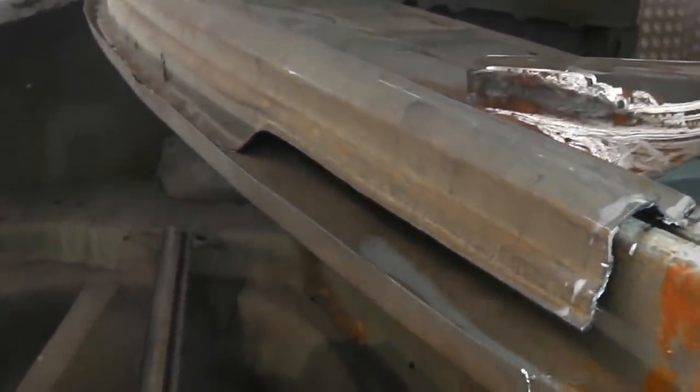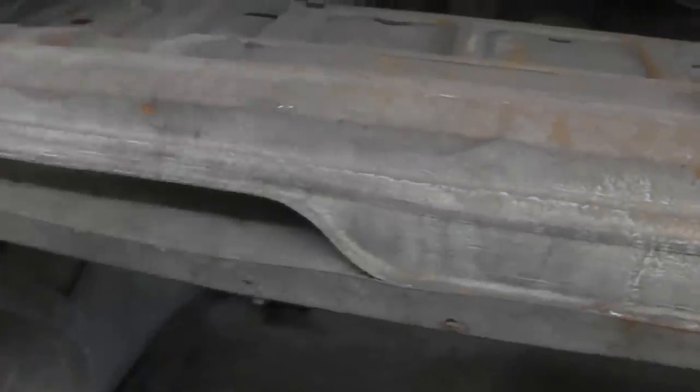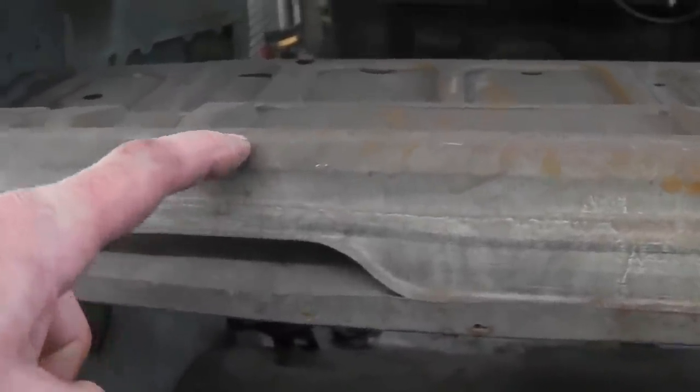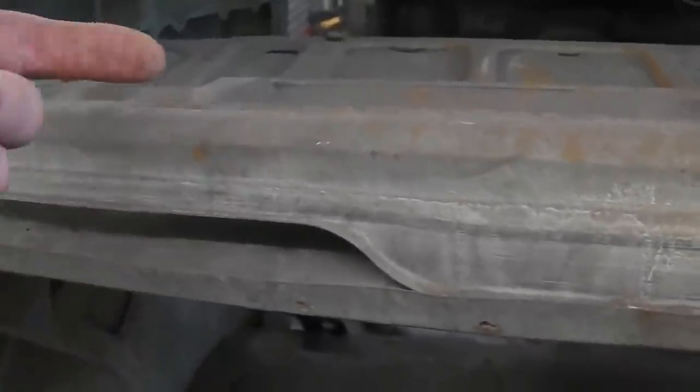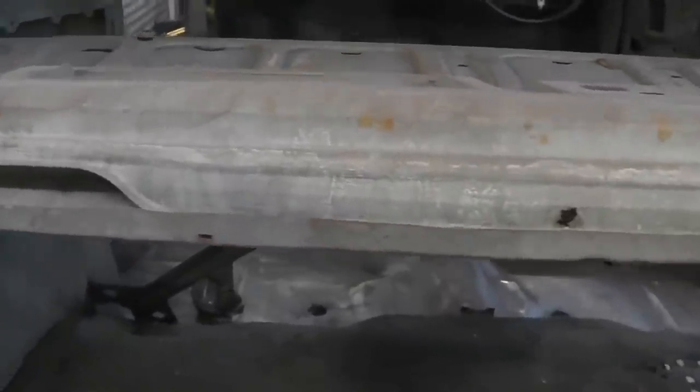So I would have thought that you've got a combination of vacuum at the back and air pressure into the cabin at the front. So that is how the air would flow through the car without you hearing the noise of outside, because the baffle inside here will help dampen the noise. It stops the rain but at the same time lets the air flow through. Where it alters a little bit is with these holes cut out in the parcel shelf, because those holes come out into the boot.